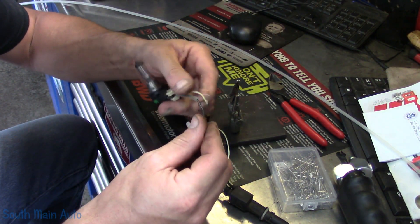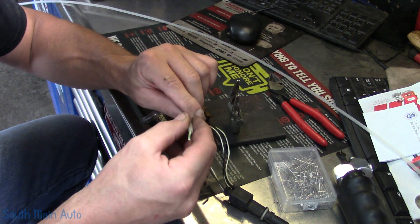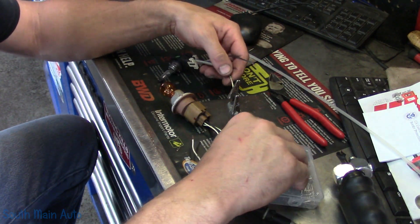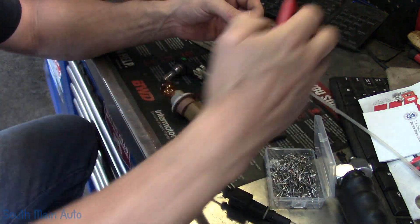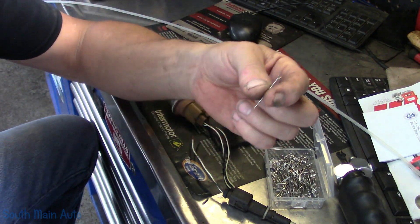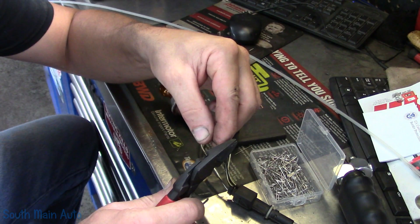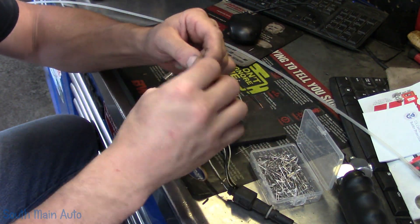These work great for substituted loads for high amperage devices. Of course, you can do a little research to see which bulb is higher wattage and draws higher amperage — this is going to vary by voltage applied. Some people are still scared of test lights because of their inrush of current, but use your head. I'm just using standard T-pins — I buy these on Amazon. For this purpose, we actually have to chop the T-portion of the T-pin off, turn it back into a straight pin.